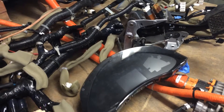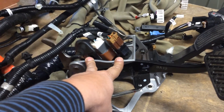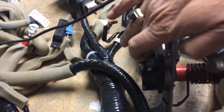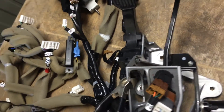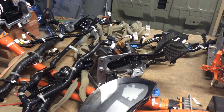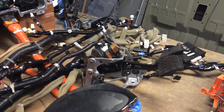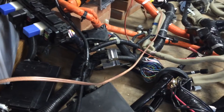If the BCM can't tell whether the vehicle is moving or not, it basically won't allow the vehicle to power on. Interestingly, it will still allow it to charge but not power up. I do still have the pedal box in place. That could be replaced with a generic unit as long as you emulate the stop switches as well as the accelerator sensor. This here is the brake sensor; the accelerator sensor is on the top of the accelerator unit. As long as you emulate those with appropriate switches and potentiometers, you should be able to control it — there doesn't seem to be any CAN controller in that unit, just switches and pots. The IPDM is still in place, as are all the other fuse boxes and relays.